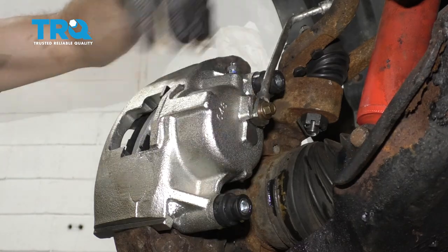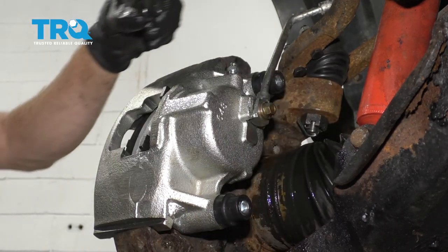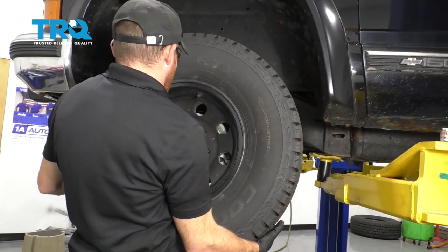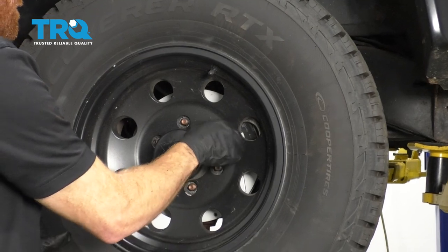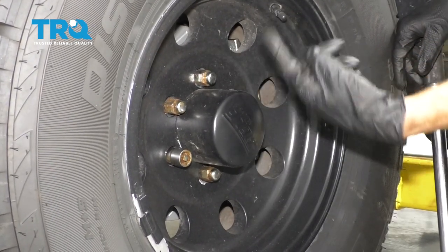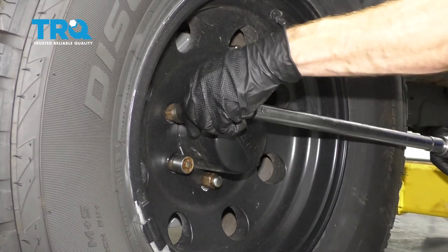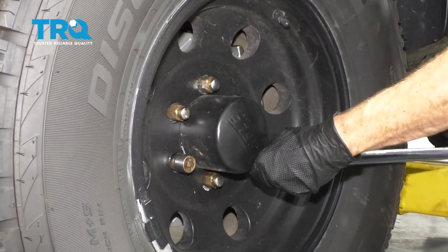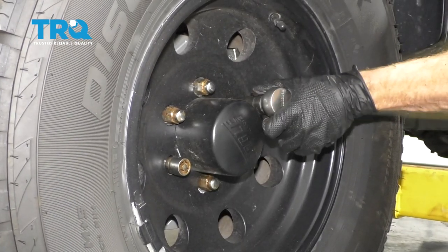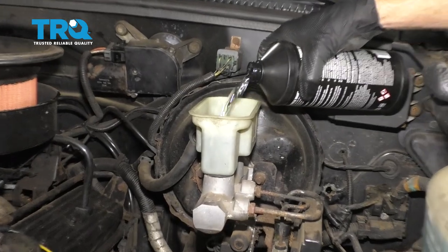The next thing you wanna do is clean down the entire area. Water works best for removing brake fluid from the area. I'm just gonna clean this down and of course put on our nice protective boot. Let's get our tire up on here. Start on all your lug nuts, snug them up, and then we'll torque them. Once you have them all started on there, go ahead and get your wheels safely back on the ground and then torque all of the lug nuts to 120 foot-pounds. Once you have everything all torqued together, go ahead and double-check your master cylinder — make sure it's up to par.